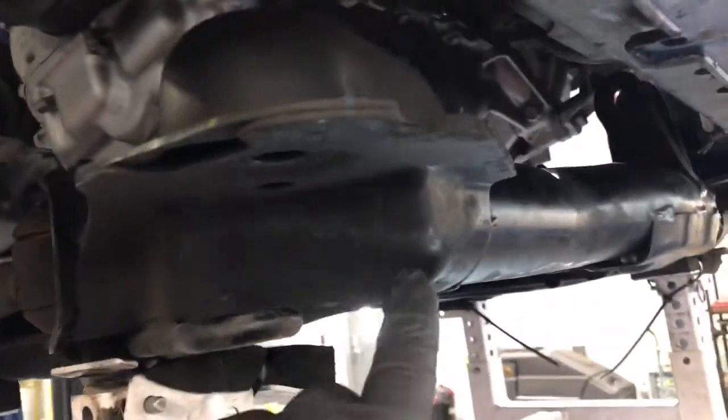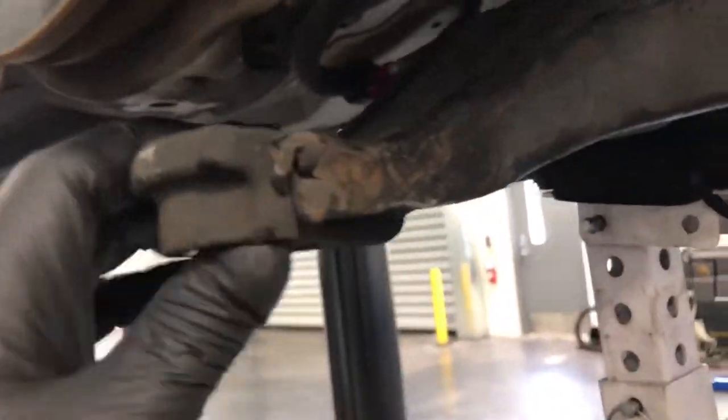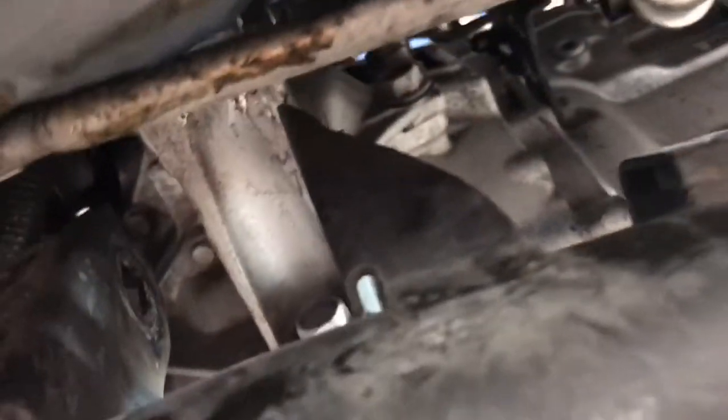To take down the subframe you have the four main bolts on each corner. You need to take off the lower ball joints on this side and loosen the rear sway bar on both sides. And then the mystery thing that keeps getting it hung up is this AC line. This AC line is bolted onto the subframe, so if you're trying to drop it and it's not dropping, you are stretching the hell out of that line right there.